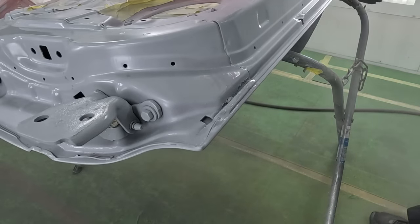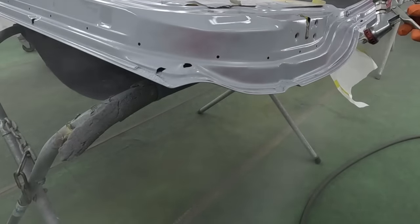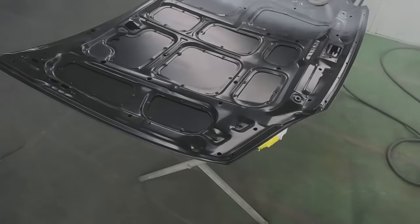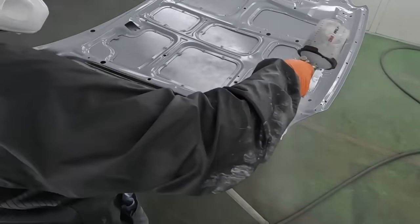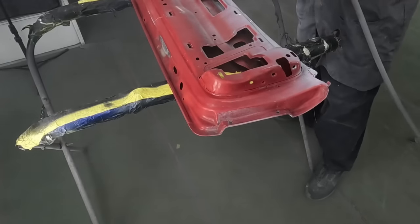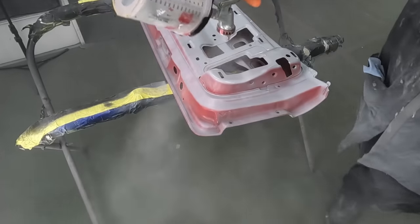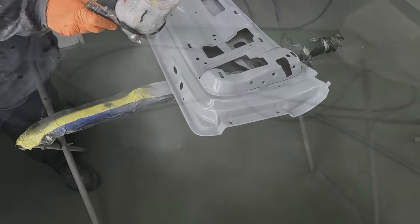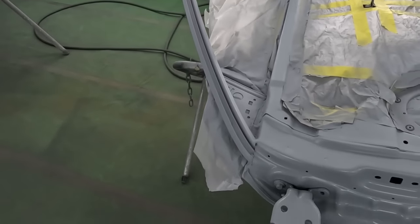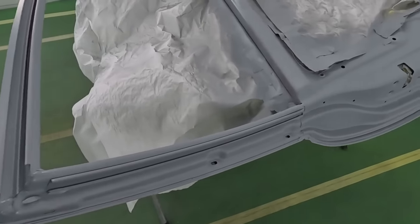If you don't want to seal, you also do have another option of fully primering like you saw in the first steps. The only downside to this is that you will have to once again sand down the primer. Sealer is meant to be painted over without necessarily long dry times or sanding. Once again, if you don't feel comfortable sealing, you can definitely primer, and then from there, you can sand the primer down and just go into this next stage.